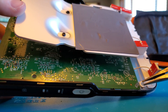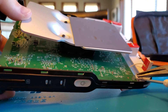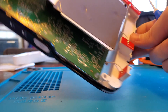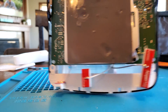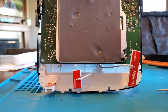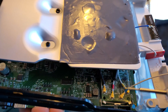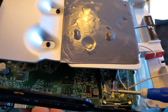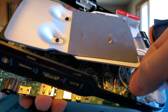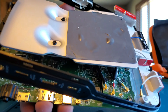Now it's time to remove the bracket that holds the Wi-Fi antenna. Just grab any sort of pliers or tweezers, gently pinching together these little clear plastic pieces, then pry up to remove the Wi-Fi antenna bracket. Once those are removed, go ahead and remove the Wi-Fi antenna cables — they were black, red, blue, and yellow. Just very gently lift these off of their pads.